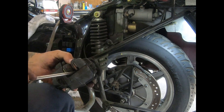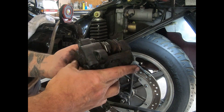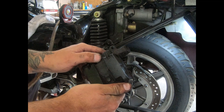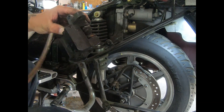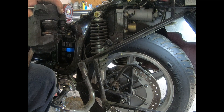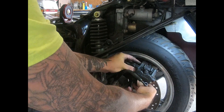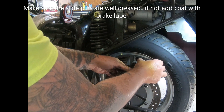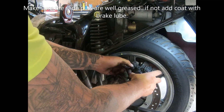This one's got good movement, pretty happy about that. Send them back in. What I like to do is use your finger and block off where that banjo bolt was, use the bleeder screw hole, and run air right in it — watch those pistons come right up. Boom, got good movement. It's well greased in there, so I'm going to run with it.